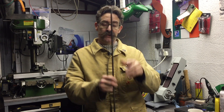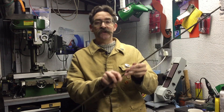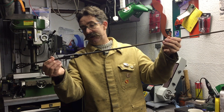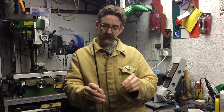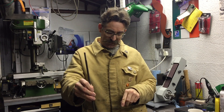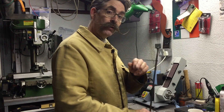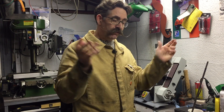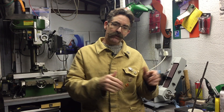So when you've got a nut or bolt that you need to replace or want to make a new one, it can be a real problem. I've got this brake rod off a 1929 Riley — I think at some point a longer brake rod was fitted and there's just no adjustment left on the turnbuckle. They're almost touching, so there's no adjustment left at all. I don't think it's stretched because it's a nice sturdy rod, so I think it's a case of different parts being fitted. Some of the old boys can just look at a nut and bolt and say 'that's a 5/16th Whitworth,' but if you dabble in all different things you don't stand a chance with so many standards out there.